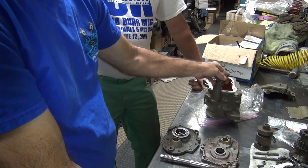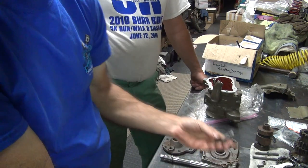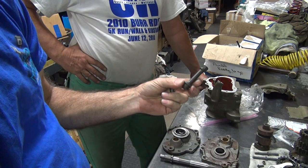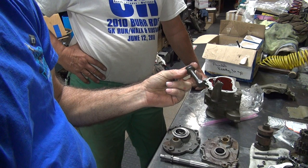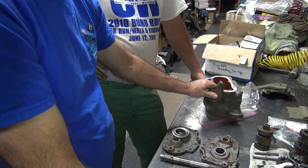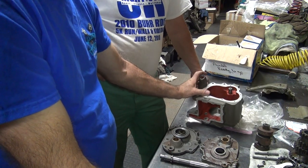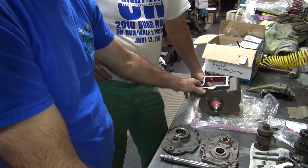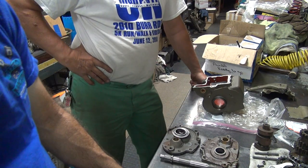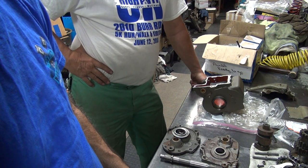All right, well, you've got either one to use. Well, let's use this one. The tall one's the one that came out of your bike. Well, this one hasn't been reparkerized. Yeah, that's okay. This one here, I don't think it's been reparkerized either, I think it's original. Okay. Yeah, enough oil on it, it looks new. Okay, well, Dave's got a new race down there that we have to see if it lines up and fits. That was a problem we had with these things, making them line up, and I can't remember if that was a problem on that one or not. Other than that, it's a good case.